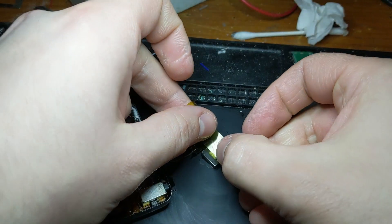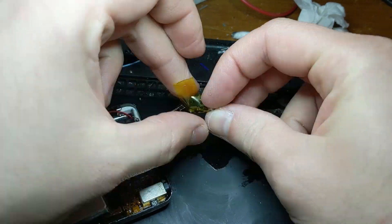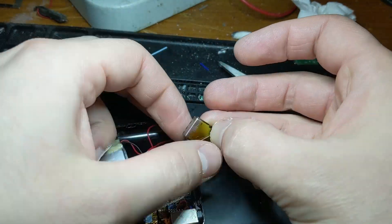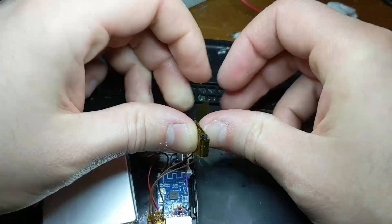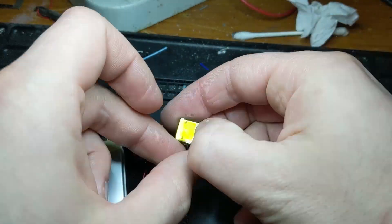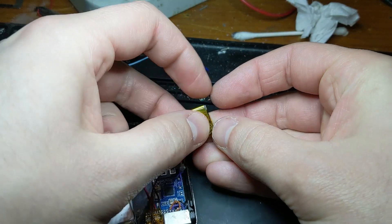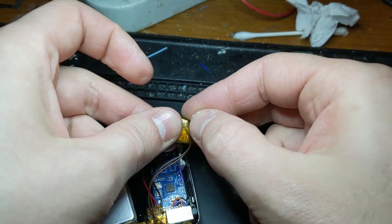Before I mount it back in the iPod, I decided to wrap it in Kapton tape as the flex cable sticking out the side was looking pretty fragile. Kapton tape is the yellow stuff that you find inside a lot of electronics — it's heat resistant, non-conductive, and doesn't leave any residue behind, so it's perfect to use in projects like this. Although you could probably just use sticky tape in this case if you don't have any. Just make sure you wrap it on tight because we'll be gluing this to the frame, and if the tape's on there loosely it'll absorb a lot of the vibrations and make it feel weaker.